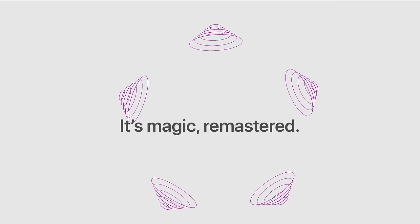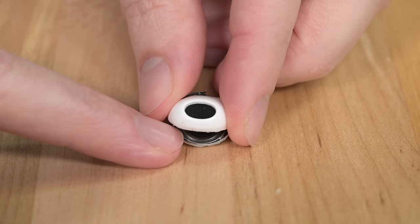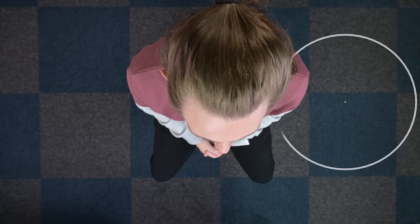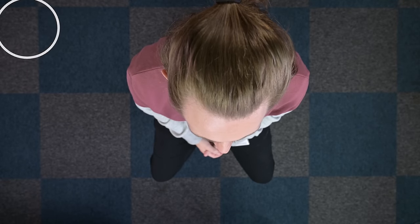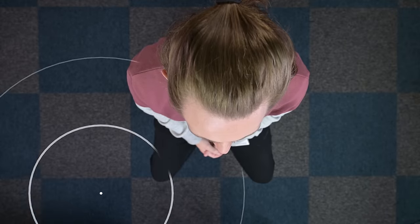So let's talk about spatial audio, because this is extremely interesting. Spatial audio is designed to trick your brain into believing that the music or movie you're listening to is coming from a certain place in space around you. It doesn't require multiple drivers — like in the AirPods Pro, there's only one driver here. What's happening is the H1 chip takes the audio file your phone is sending it and introduces a slight delay between the two buds in your ears, so one of them is playing ahead of the other. This effect mimics what happens in real life — when you hear a sound to your right, your right ear hears it a fraction of a second before the sound wave travels around your head to your left ear. By carefully calculating the time it takes sound to travel to each ear from any point around the head and putting that data into an algorithm, Apple can use the H1 chip to precisely add delays between the buds to place sound in space around you.